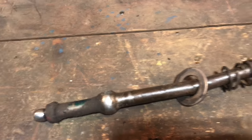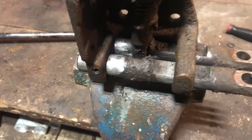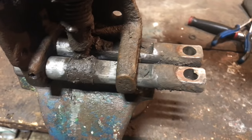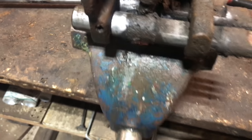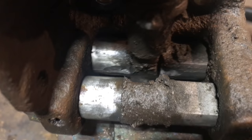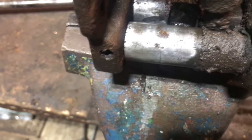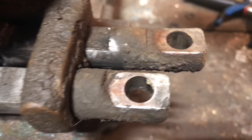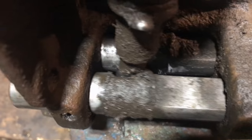Both sticks are out of the truck now. This is the main transmission stick and this is the auxiliary stick. How this works is these are those two little rods I was talking about, and then the stick slides back and forth to choose the gears. Those are the yokes that go in through there with pins.